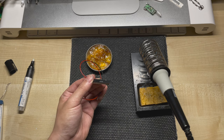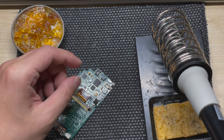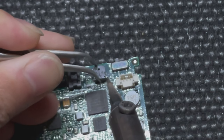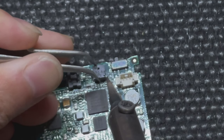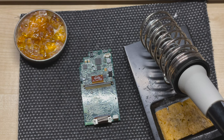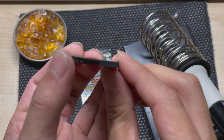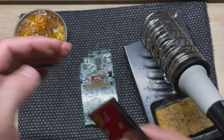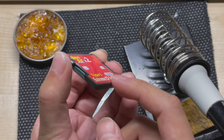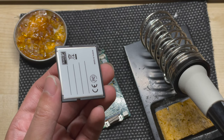Now that the Taptic Engine's all wired up we can move on to the board itself. The clicker is this component here and all I'm going to do is pull up using a pair of tweezers while melting the connections with my soldering iron. Once the joints are all disconnected we can carefully remove the clicker from the board. Before we can solder the Taptic Engine to the board there's one other thing we need to do and that is to fit and trim the flash adapter. Now most CF cards and adapters have this little tab at the end here and the problem is that's going to prevent the card from sitting flush to the board. When that happens it's going to reduce the amount of space we have on top — and that's where we're going to be putting the Taptic Engine — so we need to just trim that down. For this I'll be using edge cutters and then with the remainder I'll be using a file.